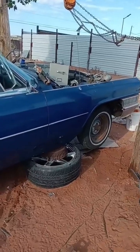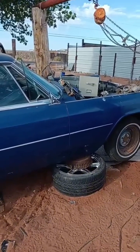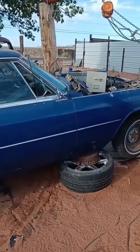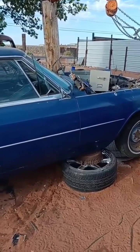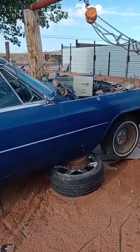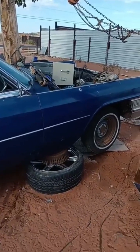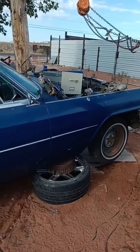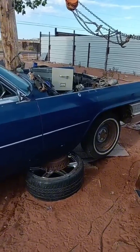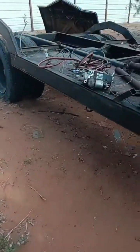So yesterday when I go to start the motherfucker, I have everything ready. It starts skipping teeth on the starter. So it didn't have any shims on it, on the starter motor when I first installed it. So I put another starter that I knew was good with shims, without shims, with less and more shims. Like I took it off already like 20 times yesterday, the whole day. I even stopped recording. I was just fed up with this hell.